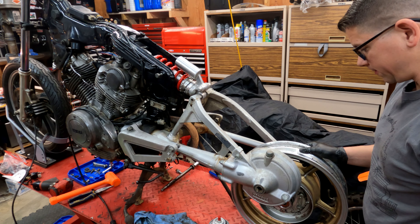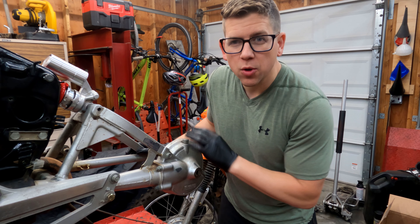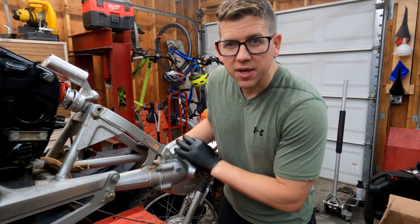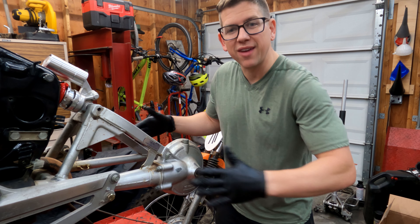There's our hiccup. Looks like the whole setup now is too wide. One quick Google search let me know that the rim from the newer second gen Virago won't fit inside of it. I have to remove the rear final drive, the differential, put it on the rim and then put it all together as one.